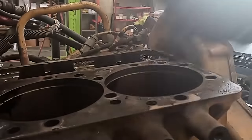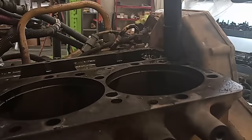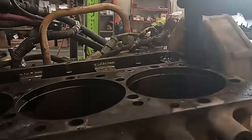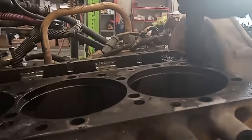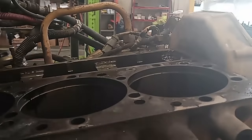The first thing we're going to do is remove our dowels. This is a slide hammer style dowel pin puller. The C-13 dowels are particularly difficult to pull out — this was about take four on filming this because it took a while to get these suckers out. Eventually they did come out, and once they're out, you now have a gasket surface that is ready to be cleaned.